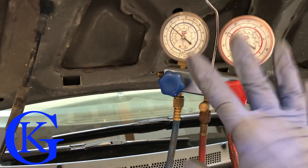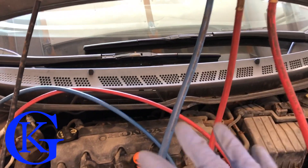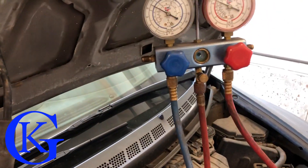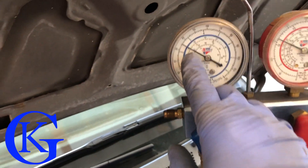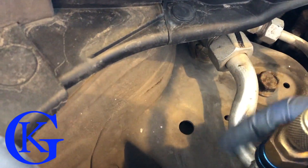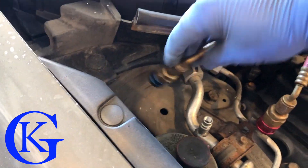This was the proper way to fill an AC system — we evacuated it, drew a vacuum, and measured exactly what went in so we know precisely how much refrigerant is in the system. A trick I learned for disconnecting the hoses is to disconnect the low side while the vehicle is running, because there's not much pressure — only about 35 pounds. With valves off we just disconnect it, and it pops off nice and easy.